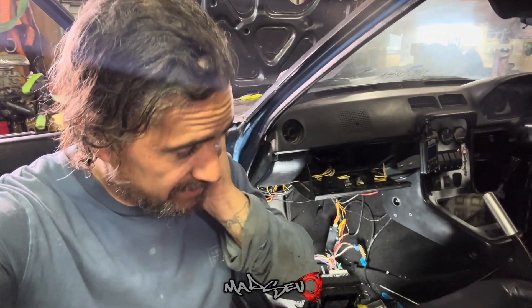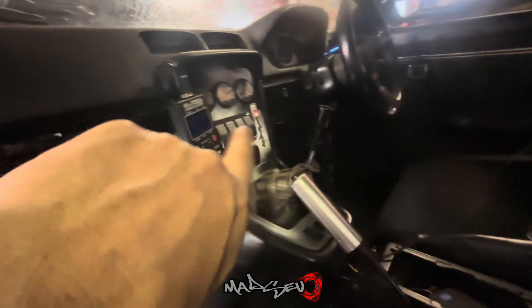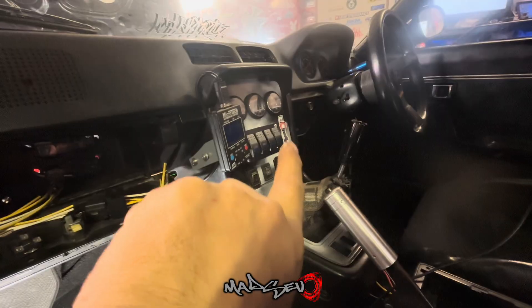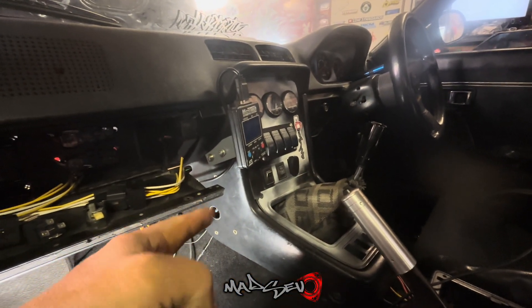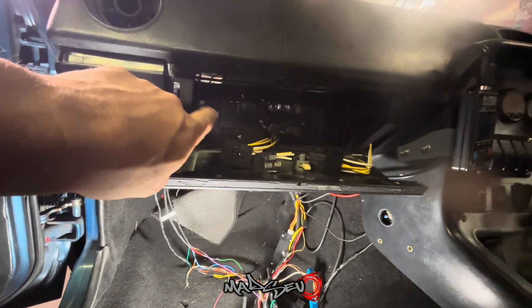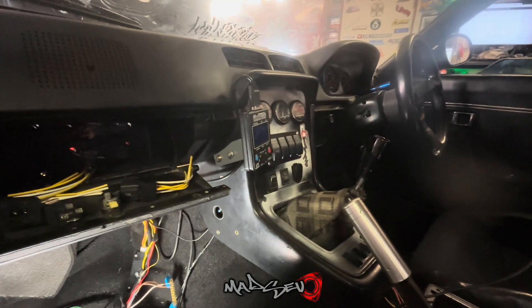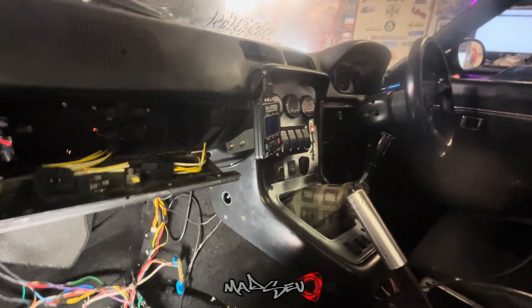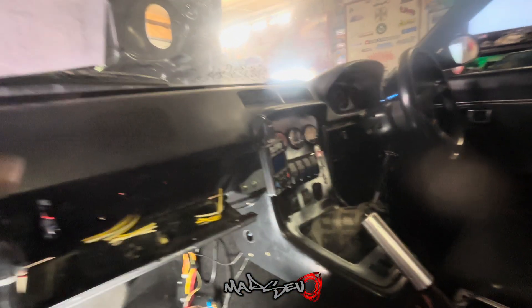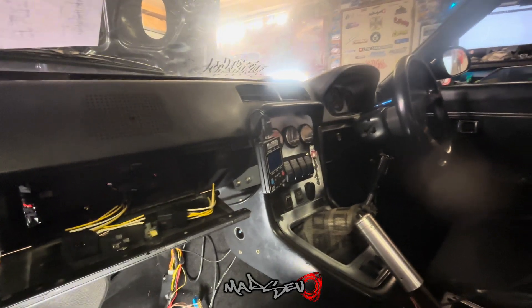Next day again and still haven't heard back from Microtech about my ECU. So we're going to press on — I'm going to get these relays wired in for the fuel pump and the electric fan and test that. At the moment my switch panel is running my fans and fuel pumps. I'll find that wiring, run it back down here, mount the relays behind that panel, find a switched 12-volt feed off the fuse box, and run those to the relays. If wired up properly, next time we turn the ignition on we should hear the fuel pumps prime, and in test mode we should see the fans come on and off. That's the goal.